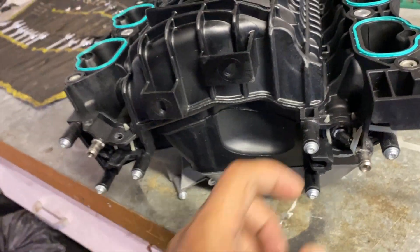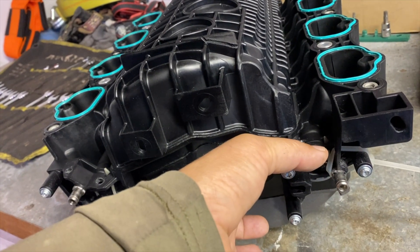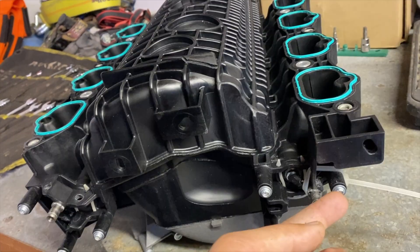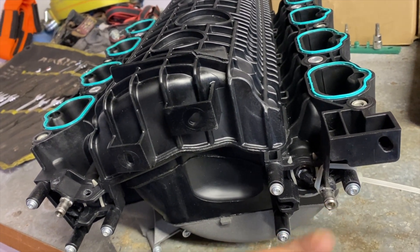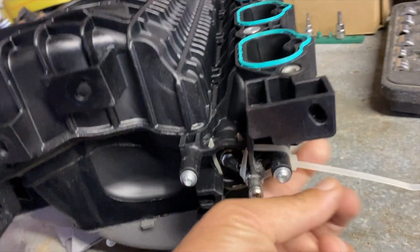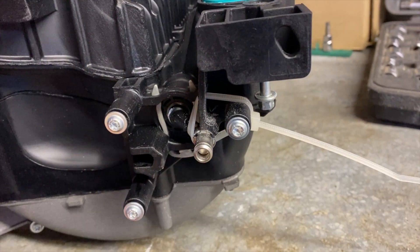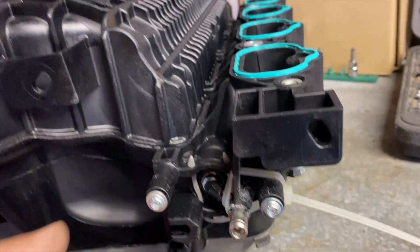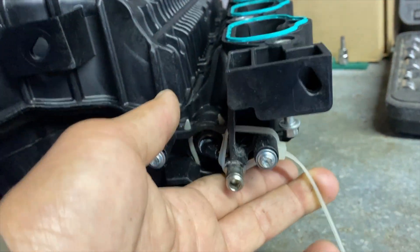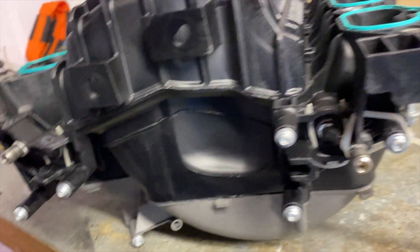As you can see right here I don't have the metal lockouts — they're actually fairly small and they go right here connecting from one of these tabs down to where you find the pivot point for your IMRCs. What I'm doing is the cheap inexpensive way, which is to put a zip tie on there. I've seen people doing this online and it works, though with the heat back here I don't know how well it'll hold up, so we may end up redoing it with the actual MMR-style lockouts, but for now this is what we're going to try.